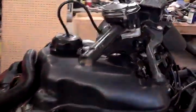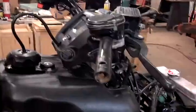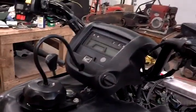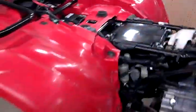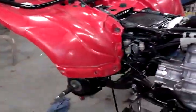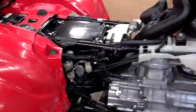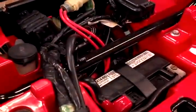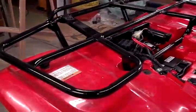I've got my gas tank on, handlebars getting more lined up, lubed all my cables, got my dash on, polished the glass lens, got the rear fender, airbox is in, filters have all been cleaned and re-oiled, all my wiring is in, battery, new used rear rack with fresh paint.